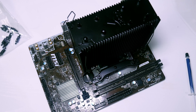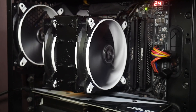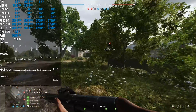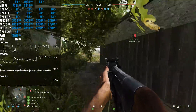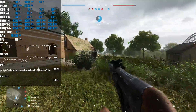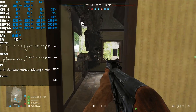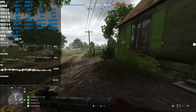I'm going to install it in my Ryzen 2600 rig and run benchmarks including some overclocking and gameplay footage. The Freezer 34 looks absolutely fantastic in the build, paired with Bionics fans. Starting with Battlefield 5 at 1440p on an RTX 2060 at low settings to stress the CPU — with the Ryzen 2600 at stock (3.8GHz turbo), temperatures stay in the high 40s and never really exceed 50°C.